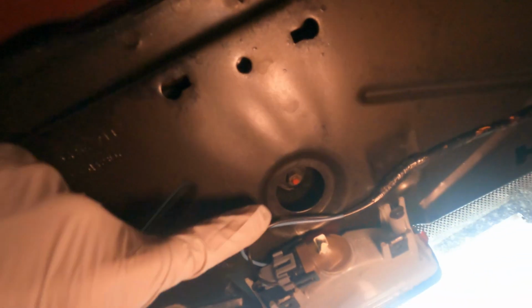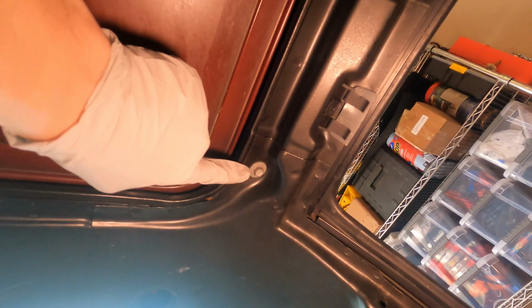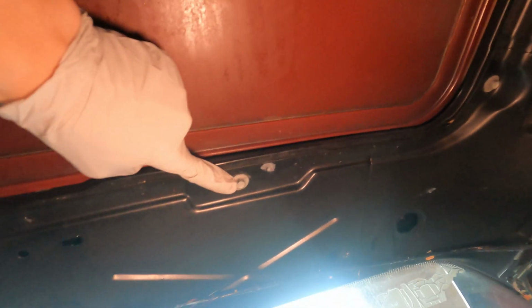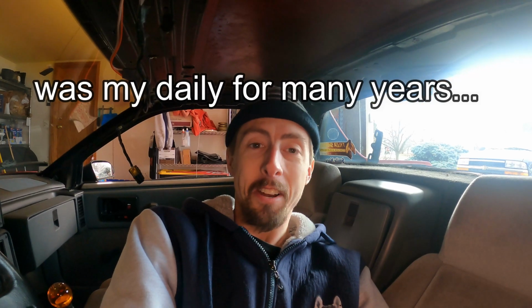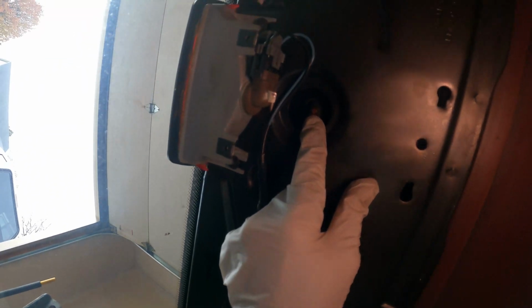To remove the studs, which are located here, here, and here, you're going to have to undo the roof bolts, which are located here, here, here, here, here, here. It's really tough to work in a Fiero compared to a Volkswagen Vanagon. It's so tight in here, it's no wonder I stopped driving it. Now that those bolts have all been removed, there's these little nuts on each of those studs that I had mentioned previously. And they're also 10mm. GM really liked metric. Meh.